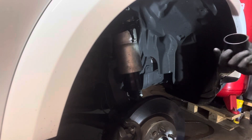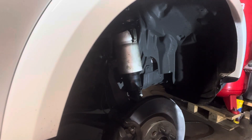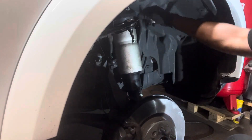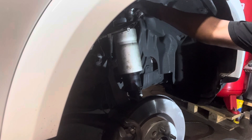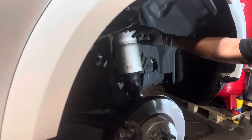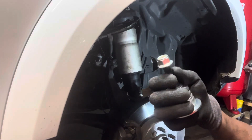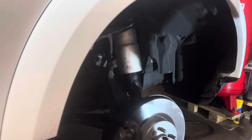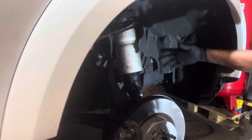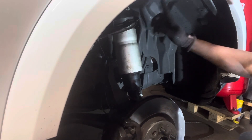The ball joint is not something too easy to remove. So what I did: I cut the ball joint. This is the ball joint — it was here just like that. I cut the top to push it out, because when the ball joint has threads it's so hard to pull out. For more room, you cut it — you get a saw or an electric cutter and cut that.